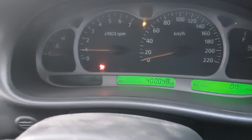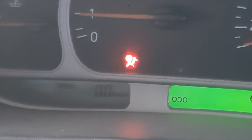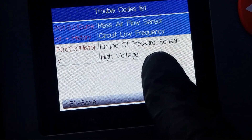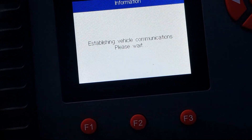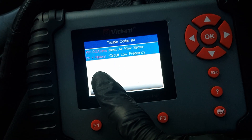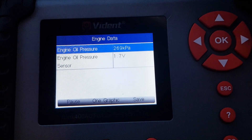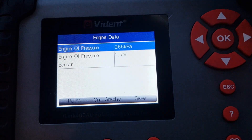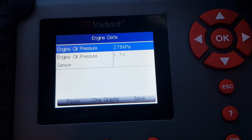I've started the car and I haven't seen any check engine light yet. Now let's check the codes in the scanner. We still have the oil pressure sensor high voltage stored, so let's delete that and see if it comes back. And just like that, the oil pressure sensor code is gone. Using the live data, we can see our oil pressure sensor is actually working — and when I rev it up it should increase the oil pressure, which it does. So we know we're in the good — that's exactly what we want to see.